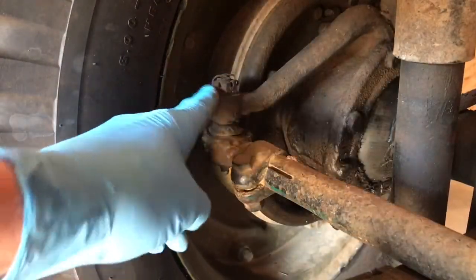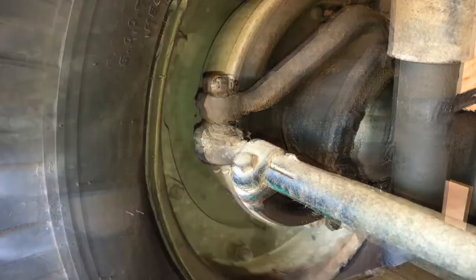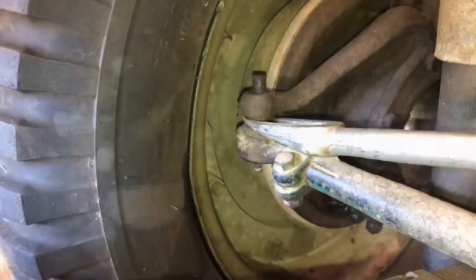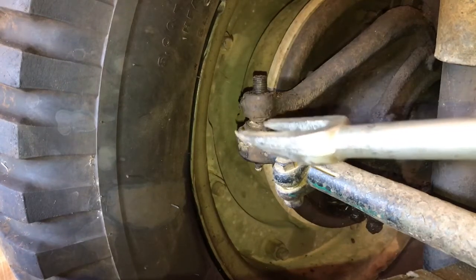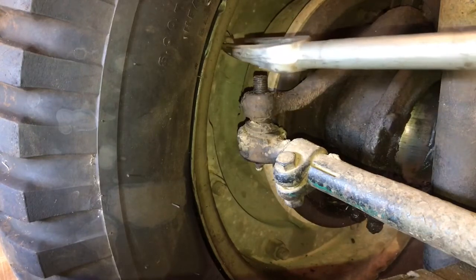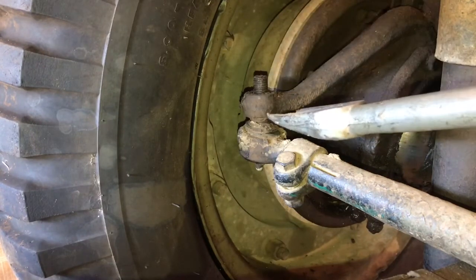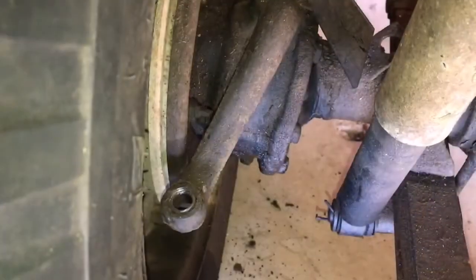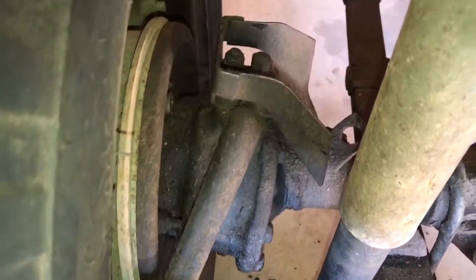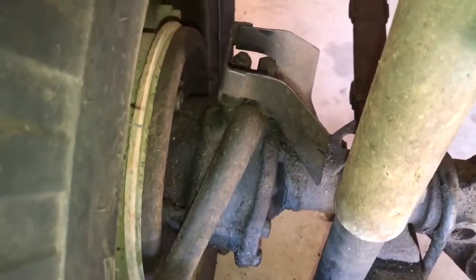Repeat the same process for the passenger side. As a note, the passenger side tie rod is the longer tie rod. I am coming at these tie rod ends with my pickle fork almost perfectly perpendicular to the tie rod. If I don't, I would wind up hitting the back of that brake plate and I wouldn't be able to put my pickle fork all the way in to remove the tie rod end. With the tie rod end separated, I will show you the steering arm and the brake line shield for the axle, and I will leave those on for the time being — we will remove those when we actually do the disassembly of the front axle.